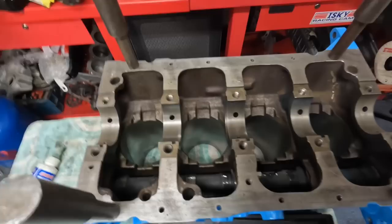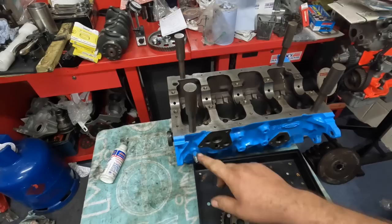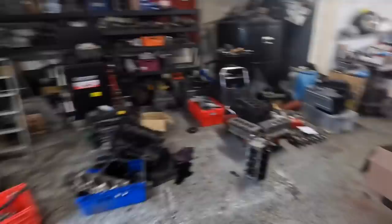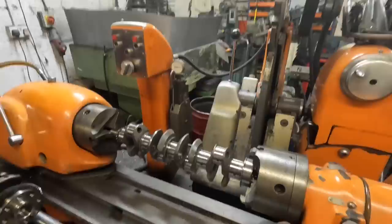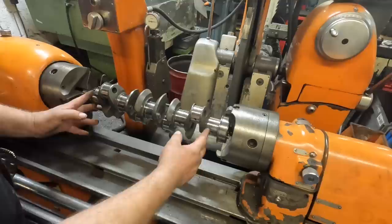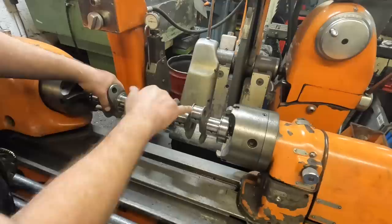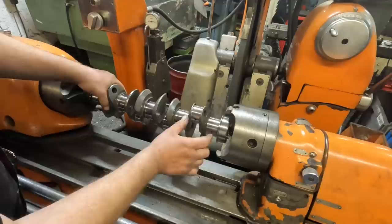We've just got the cam in the Formula Ford. I've taken a load of measurements off it to record the data. I've got some homemade block stands screwed in, so I'm going to quickly go and polish the crank, measure it, then flip this over and carry on with the build. The crank is in the crank grinder, and the reason I want to polish it is that the hard bearings on the balancer have left marks where it's rolled on the crank. There are also some little bits of wear I want to try and blip out. I also want to take care of what I'm pretty sure is a concave shape on the big ends because of the way it's wearing the journals.